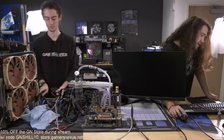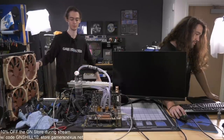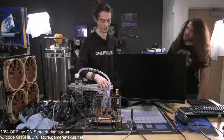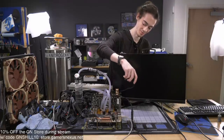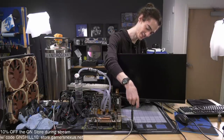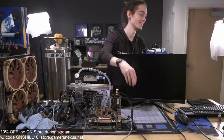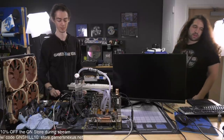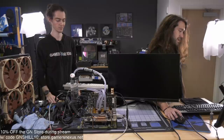Adam Schumann Sr., $2. Hook up some speakers. Yeah, I got that one. Big Al, $5. Board that old might want to replace the motherboard battery. That is actually a good point, but we'll see if it works. It wasn't giving errors when I got it to post without any cooling on any of the board components. It did do a thermal shutdown, though. Yes, and then it wouldn't post for 5 minutes. Yes, the method of hold the cooler on top of the CPU with your hand.